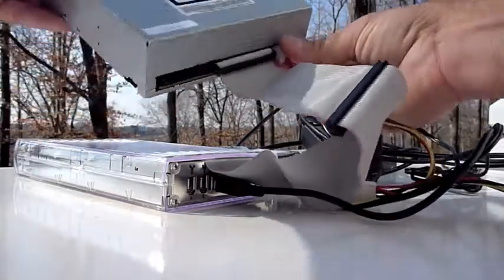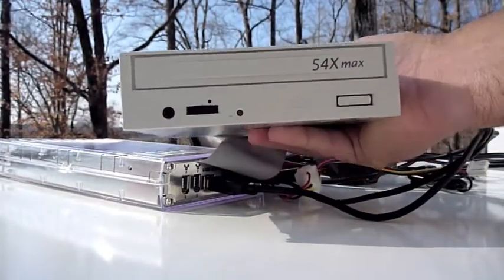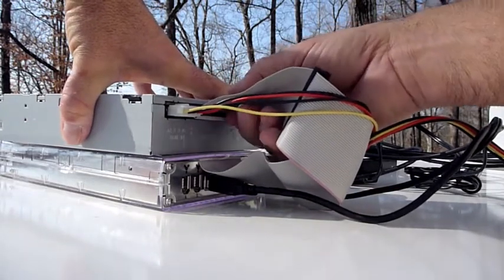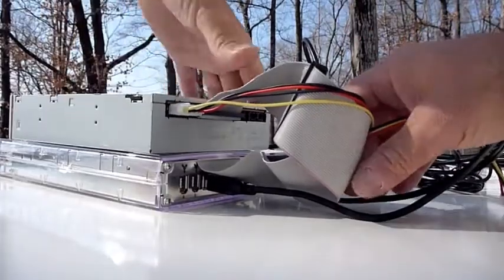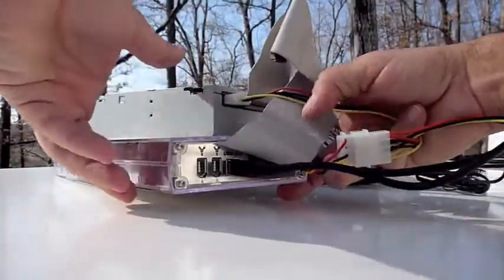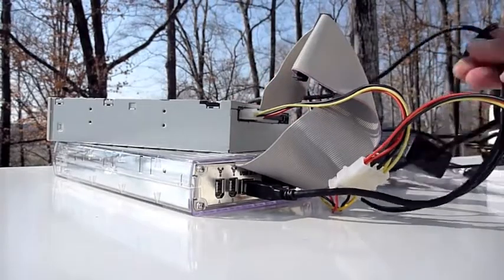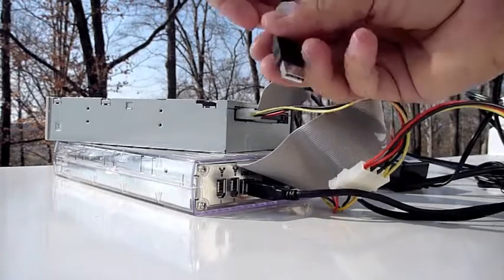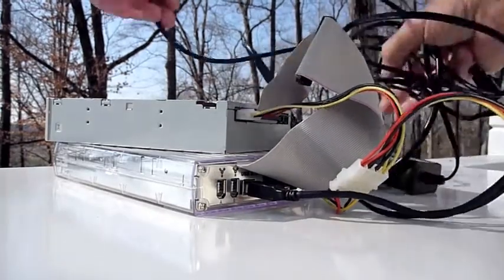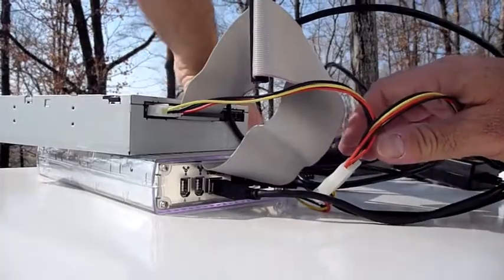Many times it was hard drives, but in some cases I need to connect something like this — your basic CD drive. So it's not uncommon for me to have a laptop without a CD drive and I need one, or I might have a tower that has a CD drive go bad. With this configuration I'm able to use this external case, which also has FireWire and USB 2 connections in the back. I simply take a USB 2.0 cable and plug this into my new computer, and I've got my CD connected. I can use this exact configuration to connect to this IDE drive.